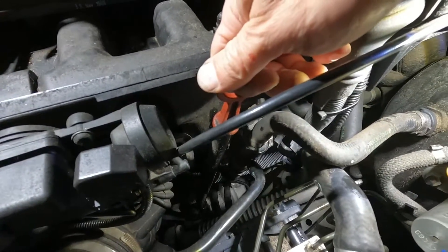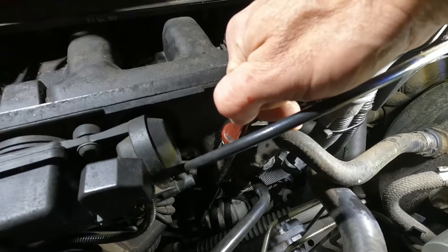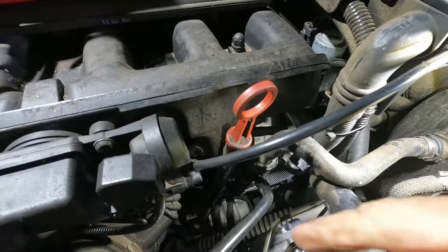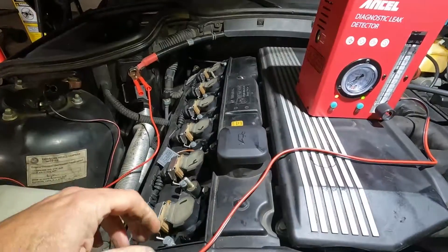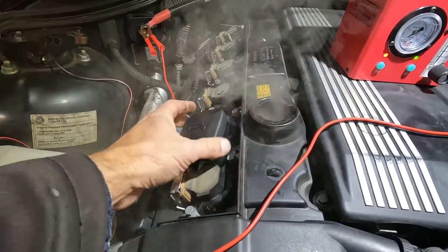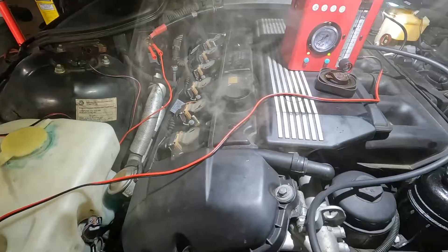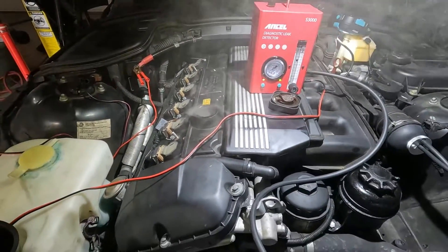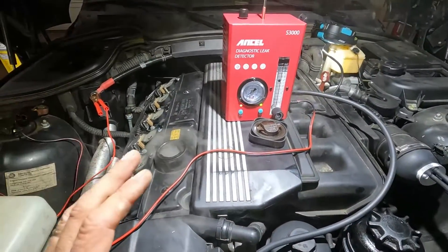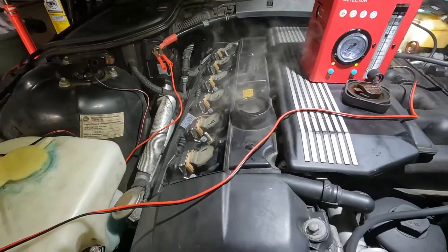What really caught me off guard is when I pulled the dipstick off — there's a lot of pressure here, gotta be careful. The oil came out! There's so much pressure in this engine that it's pushing the oil out through the dipstick. And it blows the cap right off — there's that much pressure. So you really know whether you have a leak or not because of how much pressure this Ancel smoke machine pushes out. It's pushed its way through the intake manifold, through the valves, and into the engine compartment. So if I had a leak coming from my valve cover, I would know it.